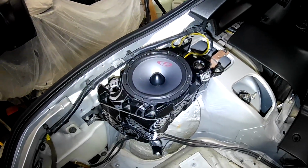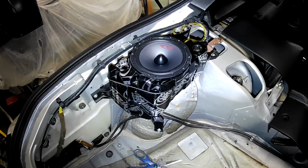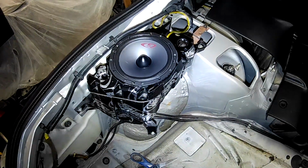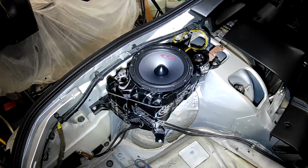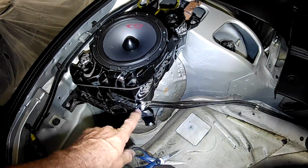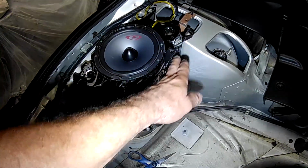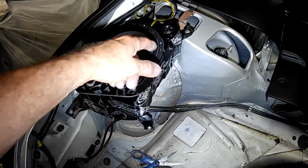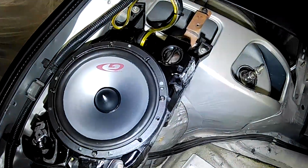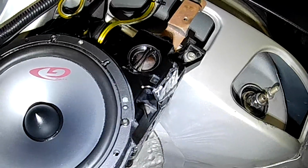Just quickly, one thing I didn't mention while I've got this left hand side speaker enclosure uncovered. Where I've got the tweeters in here, these boxes are originally ported from the factory, so they have a hole and a stick that runs down inside that's a port thing. All I've done here is drill that out, got rid of the stick thing that goes down inside there, and did it pretty precisely so this tweeter will just sit nicely in there, and then bonded it in with some urethane on the back.